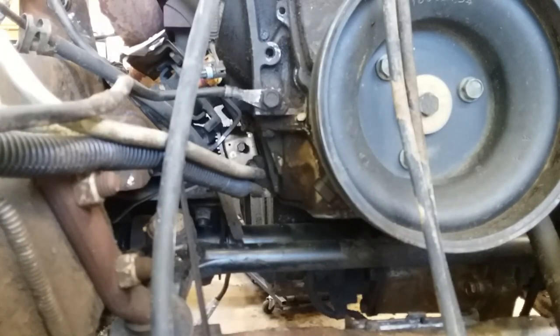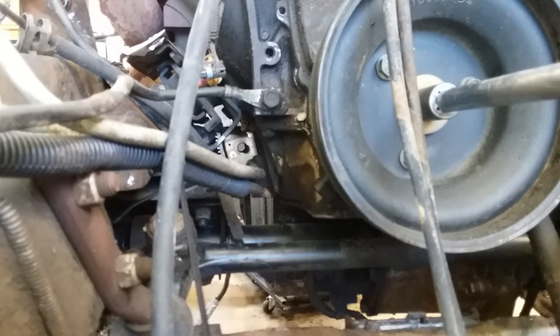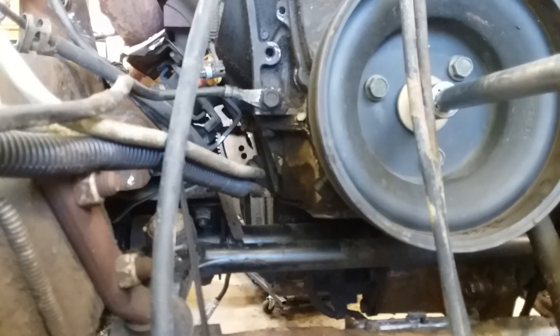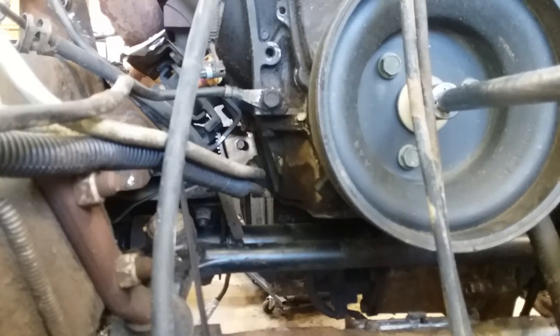Way up inside of there, if you can look and see — I've got a flashlight shining kind of in the center of the camera — on the torque converter bolts. You roll her over; it takes a 5/8 socket here on the crankshaft, but there's a little dust shield underneath the starter. You pull that dust shield off, roll the engine over gently, and you can get to the torque converter bolts through the starter hole. So we're going to unbolt the torque converter bolts and then we'll be ready to start taking other stuff apart.